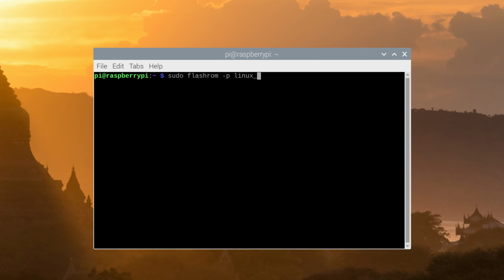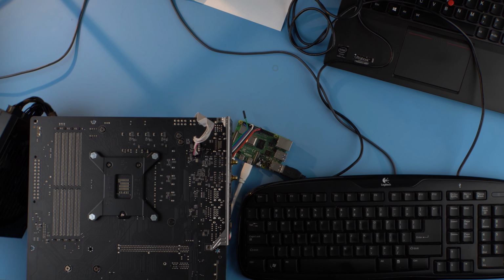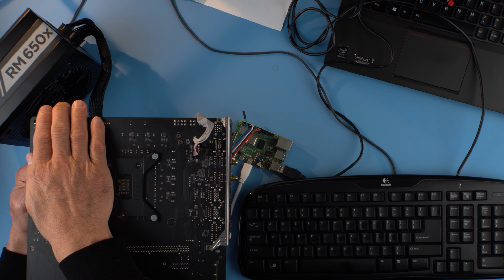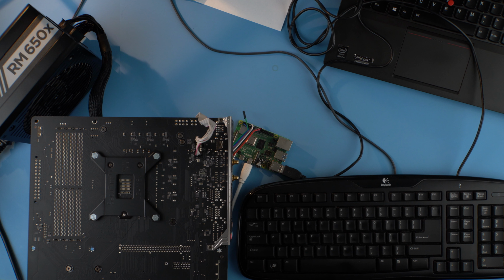While the official instructions tell you to try reading the flash memory before you connect the power supply to the motherboard, I found there is enough residual voltage to get 2 successful readings before it failed. There's no harm in connecting the power supply first, as long as you take at least 3 readings and compare the checksums of each. Plug in the 24-pin ATX connector to the motherboard and turn on the power supply. The LEDs will light up.